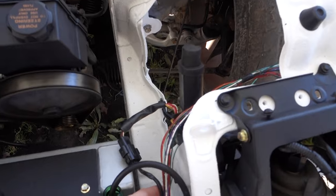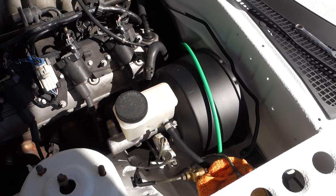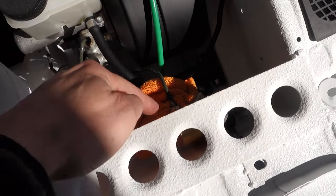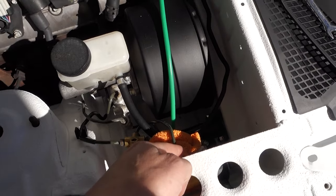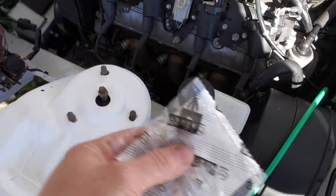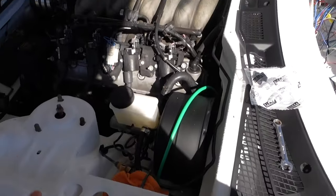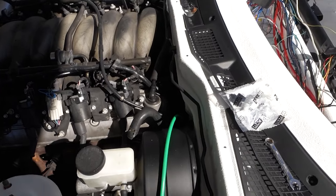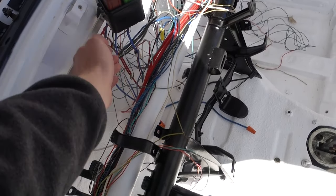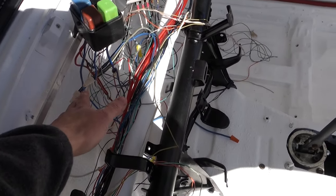We got the wiring harness laid in the car. Got the brake system and everything done nice — I was running a Nissan 350Z one because it's what I had and the factory was messed up, but we got the lines and everything back up. I got roll control back here but one of my flares is leaking so I have to take that off and reflare it. Picked up these little original Mazda clamps because she wants to look factory and neat. The engine bay caught fire so all that stuff got burned up. The wiring is still a mess but I have this little relay panel which I'm gonna mount down here and make it neater.